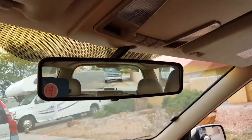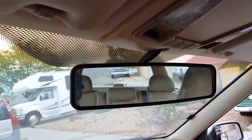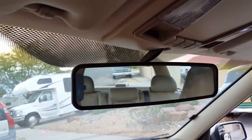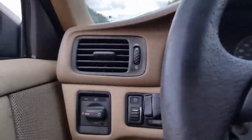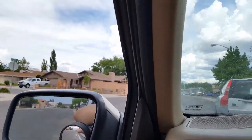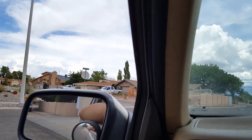See if you can see the shake here in the mirror. Yeah, it's pretty bad. 154,000 miles. I did everything — I did a compression test and got no more than 100 psi wet on all cylinders.